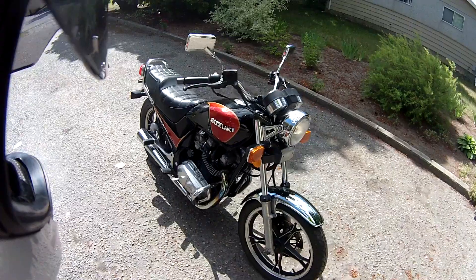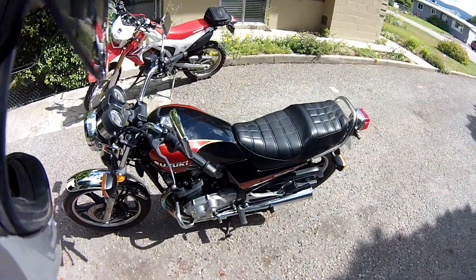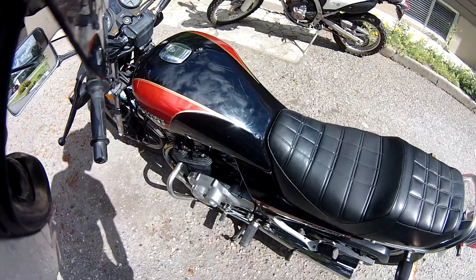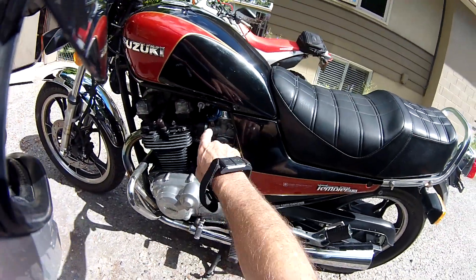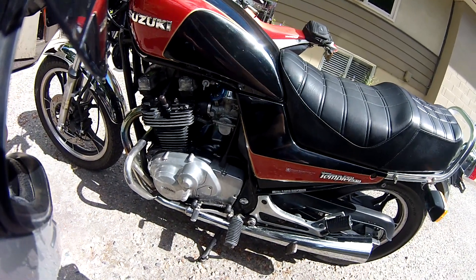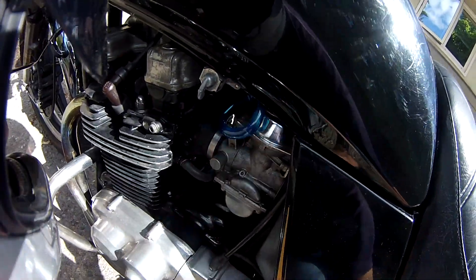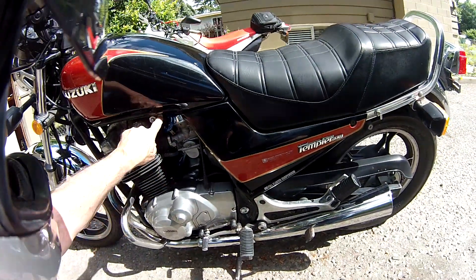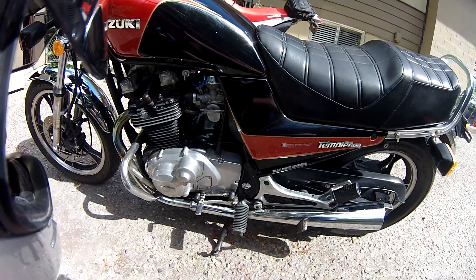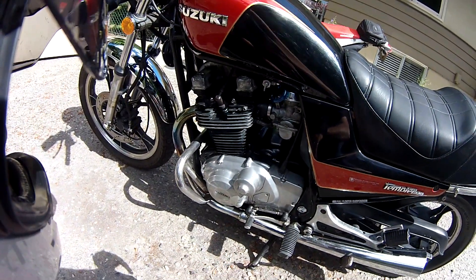Some problems to sort out. The bike wasn't exactly as advertised, so I know I slightly overpaid for it because there are some problems to fix that I was told weren't. The tank is badly rusted inside and it's running a little bit of rust into the fuel line. The guy put on an inline fuel filter with a very cheap fuel line that is all kinked. The vacuum line is kinked to the petcock, so the petcock only works on prime. There's no air filter in it — hopefully it wasn't run without one.